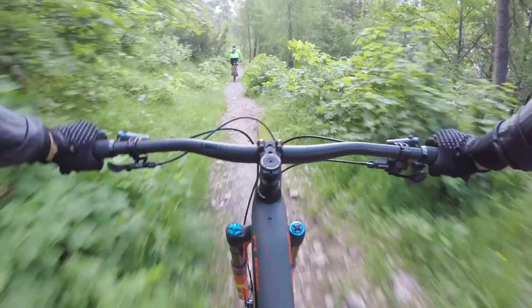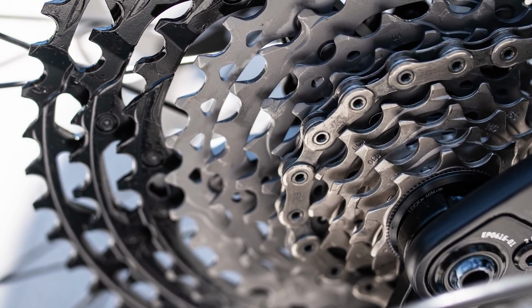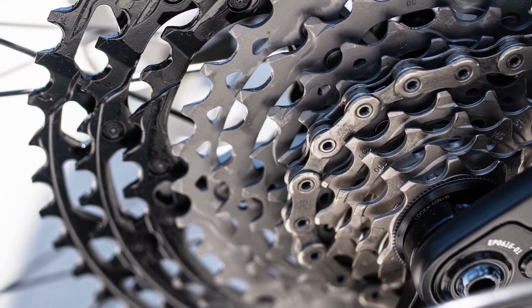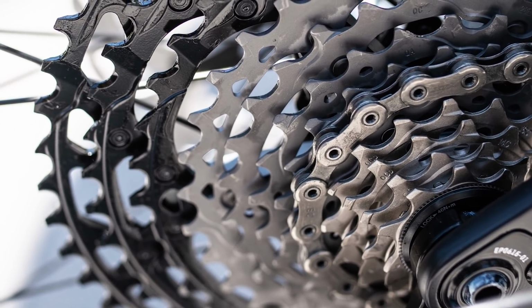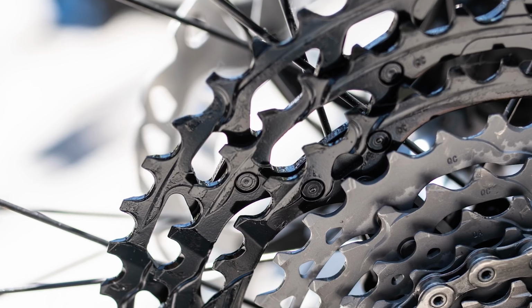In the short amount of time I spent riding XTR, obviously the wear on the cassette was something I couldn't measure, but it's interesting that the cassette is made of 3 different materials. The bottom 4 gears are made of steel, so that's where there are fewer teeth, so more load per tooth. So the heavier, more durable material is used. In the middle of the cassette are titanium sprockets, and this is to give a balance between lower weight and durability. The top sprockets are aluminium.